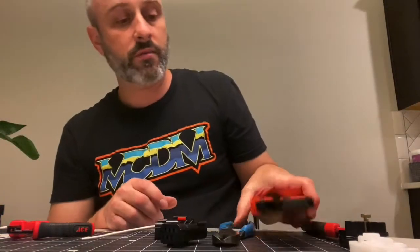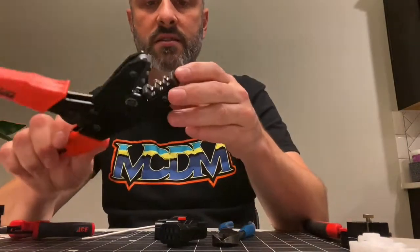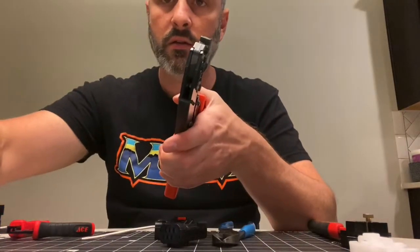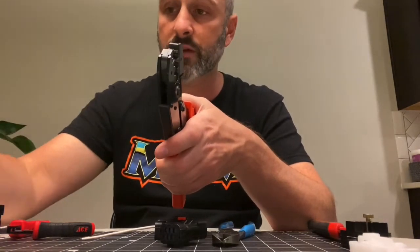Use really good barrel crimpers. I got these at HughesHandbuilt.com. They are ratcheting. There's three sizes. They're double barrel for your standard OEM-style spades. And for the new school ones that we're doing today, the spacing's the same — they use the same crimpers width-wise.